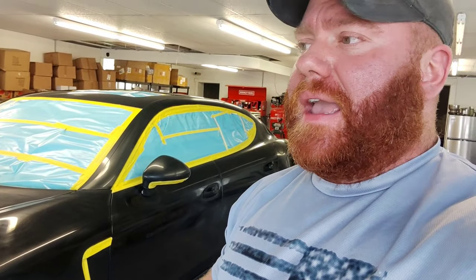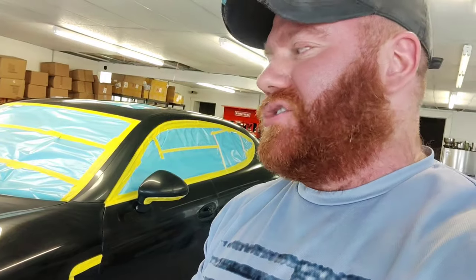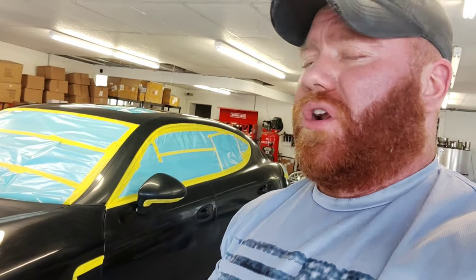My method today — I am not going to be using primer sealer. I haven't talked a lot about this with you guys, but primer sealer on extremely hot days will chalk up. It will leave that dry sandbox-like texture. I don't like using it on extremely hot days. So we are going to grab some Nardo Gray Base from Speedo Coat. I'm going to throw some slow — if I had extra slow, I'll throw extra slow reducer in there; if not, I'll use slow. That's going to give us a super flat foundation to put that single stage on top of.